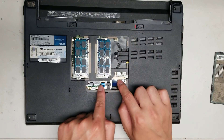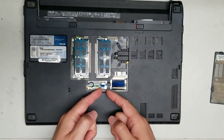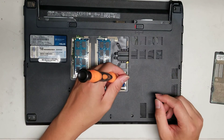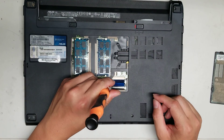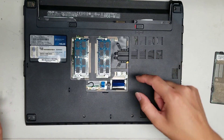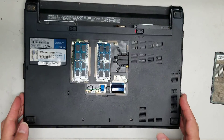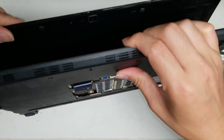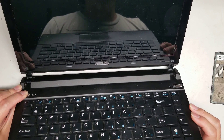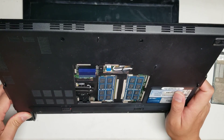There were pieces of tape covering these. To open it up, flip this little latch up for this one and then you can disconnect this cable. For these little black tabs, you'll have to use a screwdriver or something and just push it forward. Pull those two black tabs forward or out, and then you can pull the connector out. After taking out the battery, I recommend holding the power button for about 15 seconds just to drain any remaining power so you don't damage anything, especially if you have to take out the LCD connector.